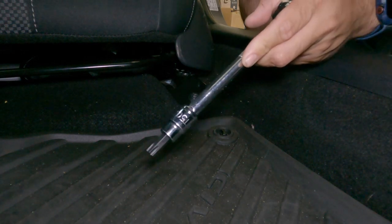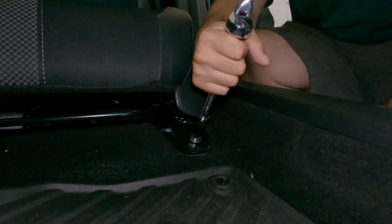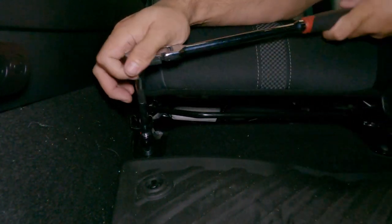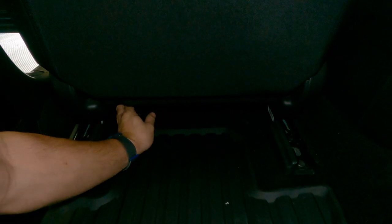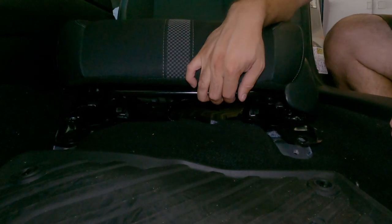Moving to the inside of the car, we are going to need a T50 Torx bit to release all four screws from the original seat. It's very simple — you just have to make sure you can see all of the wiring harnesses. There are two in the front and they come out fairly easy, and you also have two in the back. Push the seat a little bit more forward just so you can see all of them. They're a little stubborn at first but they come out fairly easy. Also, if you have any lighting accessories attached to the seat, this is the time to remove them.